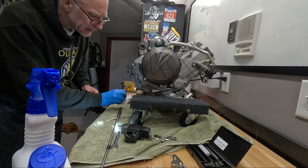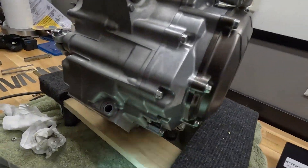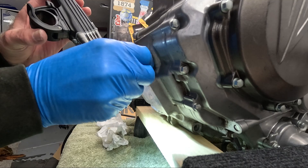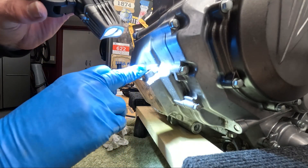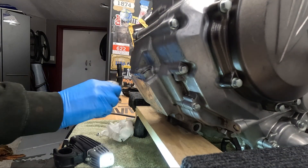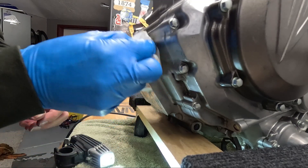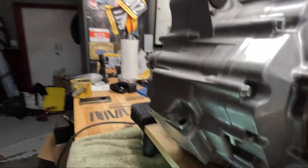I'm going to try to clean this out as best as possible. See that — it's kind of sunk, so that when the insert goes in there, that ridge will make it flush. You're going to want to clean that out, run some old oil through there. I'm going to do a top end rebuild on this anyway so I'll be flushing it out.